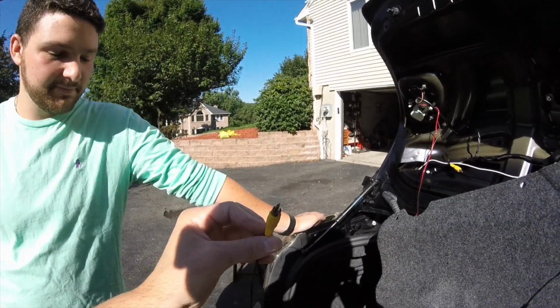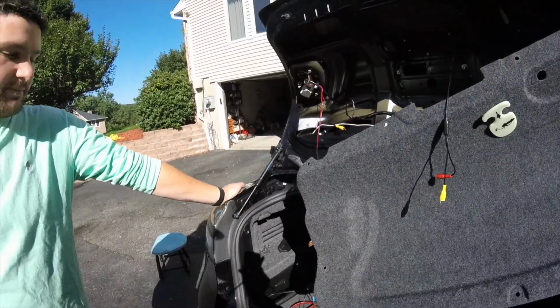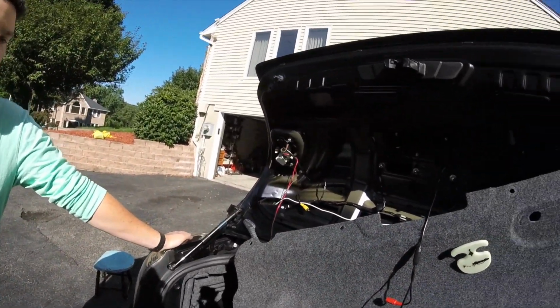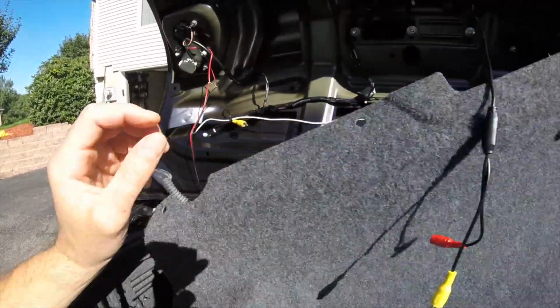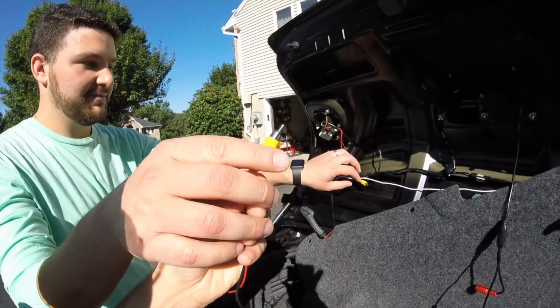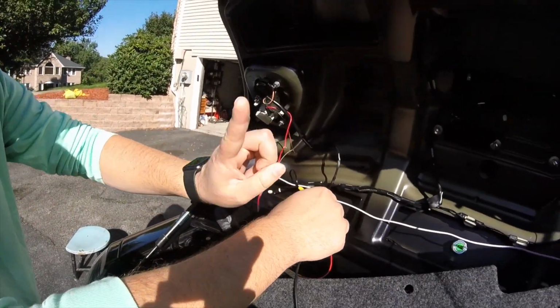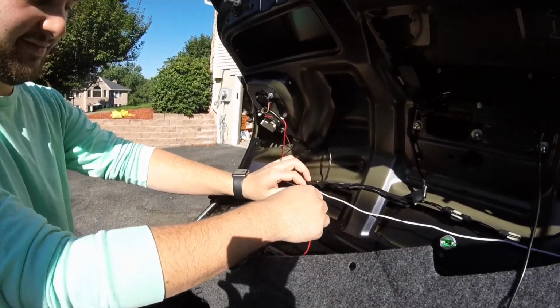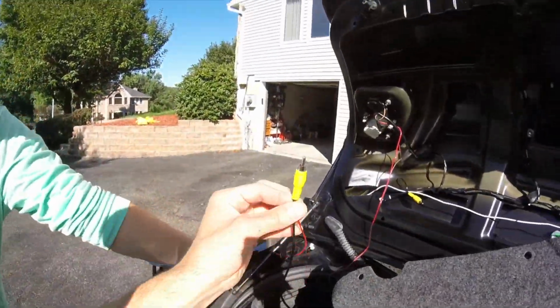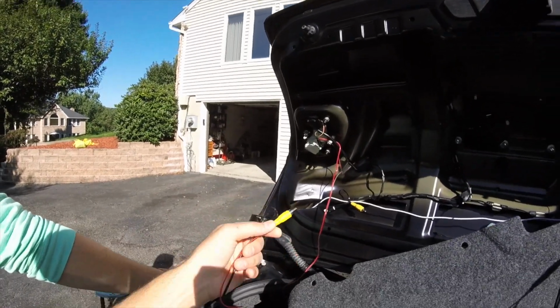So we're gonna go ahead, pull the radio out, plug it directly in, test the power and the camera to make sure that this is a camera issue and not a head unit issue. Is that correct, sir? Sounds good. That's correct, man. Houston, we have a problem. We have a male and a female, but on the new one, we have just a male. So the male can't go into the male, unless this is modern day America, then some other things work. In the world of male, female, doesn't work, and this needs to go directly to the radio.